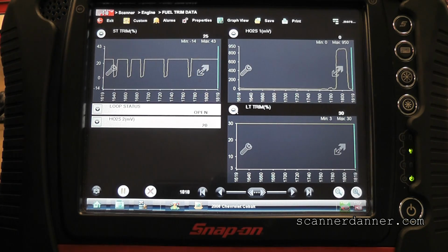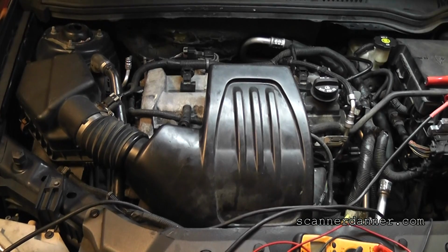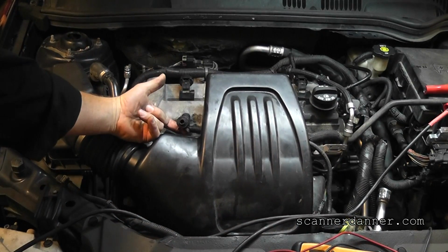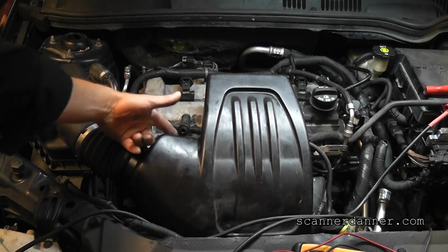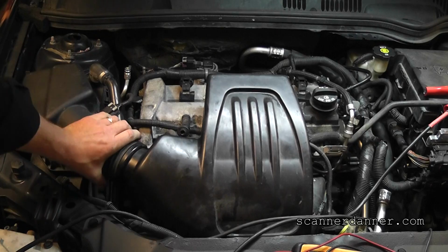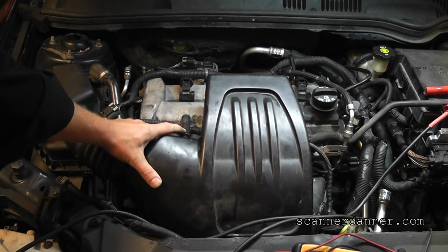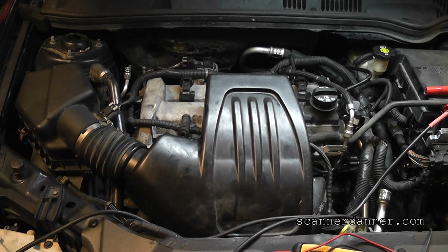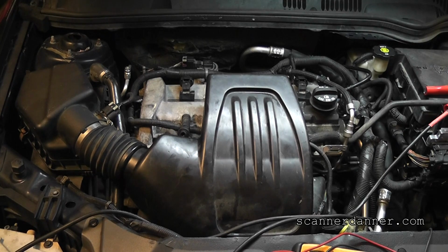All right, that's good enough. I'm not going to stress about this. What needs to be corrected is this PCV line is broken going to the air cleaner housing. And then the mass airflow tube itself, the corrugated tube, is crushed underneath. So this needs to be repaired, which is part of this housing. That housing needs to be replaced before we go any further. It does not need another engine. I think we're pretty happy about that. Everybody else will be happy about that.